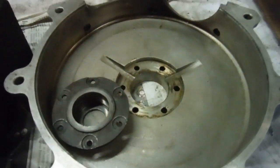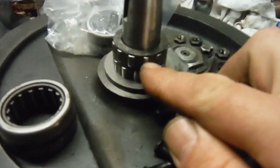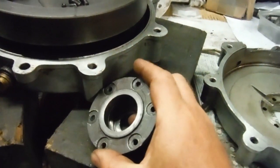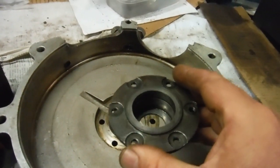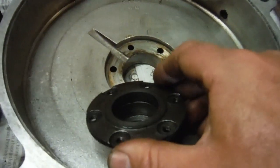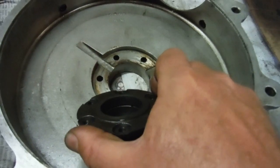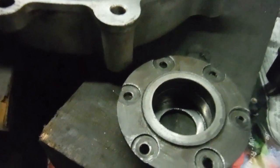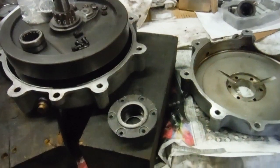The drive side didn't fare so well. I've got a new main shaft in it and new rollers for the main bearing, but the problem is I couldn't get a replacement for the outer race on the drive side — it's a bit unusual. The surface of the race is quite pitted and a bit rough, so it certainly wouldn't work very well to just stick new rollers into it, because it would probably rumble and start wearing out quite fast.